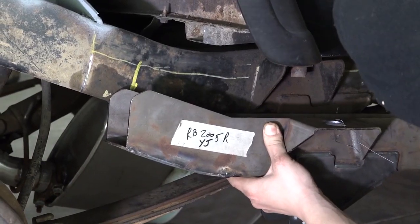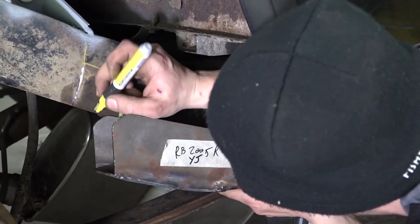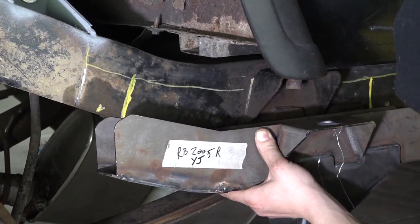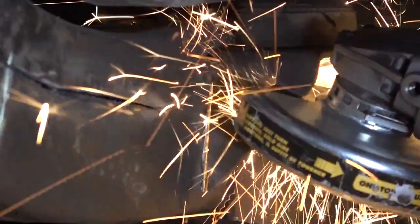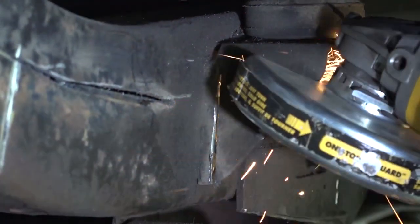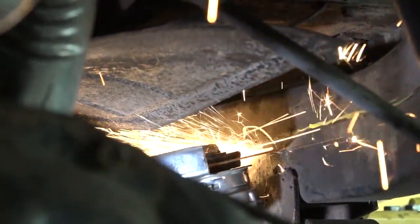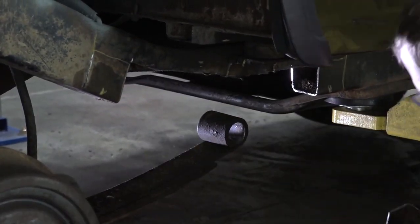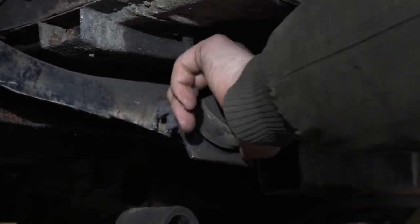Pull the replacement up to the frame and take note of its measurements. Measure 1.5 to 2 inches from the top of the frame rail and draw a line. The space above the line will be retained and used for welding. Step 4. Begin cutting away and removing the section while following the drawn lines. Once you've cut the body mount bracket free, remove and retain the bushing as it will be reused later.